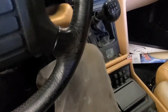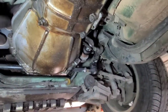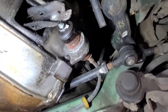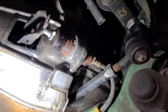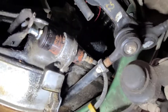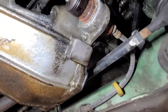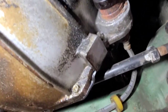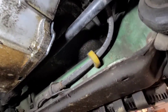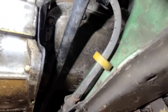I wonder if this will fit on my hoist. Here we're looking underneath this Alfa Romeo. There's some oil seeping. Looks like this clutch slave cylinder has been replaced — that's fairly recent. There's not excessive play in the clutch, and there's nothing preventing the pedal from going down to the floor. No floor mats or anything like that. I don't know if there's any oil on the clutch — it looks dry inside there.